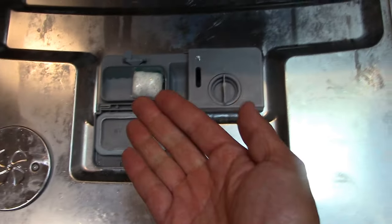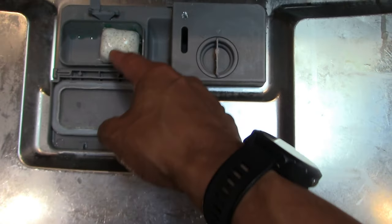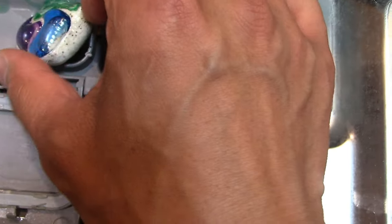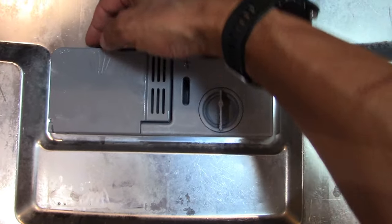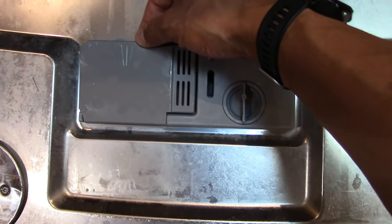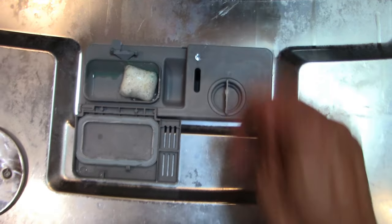So this is what was initially confusing. You look at this and see — if you just jerk the door open and didn't pay any attention, it would just look like this. You would open it up and see that the dishwasher detergent dispenser door is open, but this packet seems virtually untouched. You can see some liquid leaking in, and if I flip this thing over, you can see it's a little bit dissolved but really mostly intact. So what this has led me to believe is that the door is shut and the cycle is going, and then at the appropriate time the latch — the motor or solenoid — will try to open this, but for whatever reason this door will not open all the way. Therefore, this detergent doesn't get dissolved, the cycle finishes, you open the main door, and then this thing flops open like this.